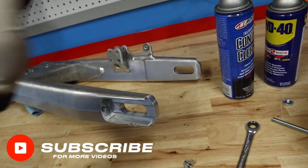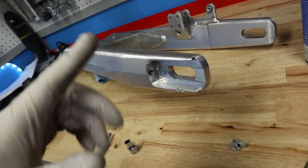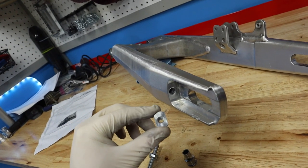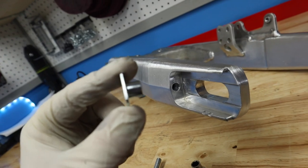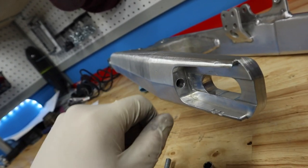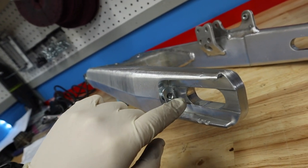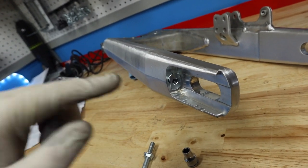Got the swing arm cleaned up. I actually went ahead and installed one side already — I like to do that just in case I come up with any hang-ups. I did actually come up with one hang-up. What I learned with this kit is it's a very tight fit, tighter than the swing arm buddy, which is a different brand of fix-it kit. The drill bit that drills this hole out is not quite perfect for this adapter insert. So what I did was drill my hole out and just kind of worked it around, made the hole just a tad bit bigger so that this gets started. Once you get that started, you can go ahead and drive it in with a drift — hit right there, just work it back and forth until it seats in. Very simple process. Let me mount up on the tripod and I'll show you how to do it.